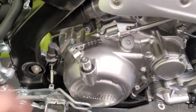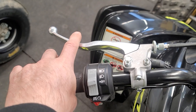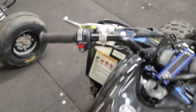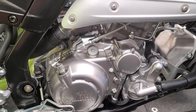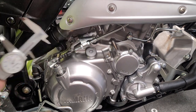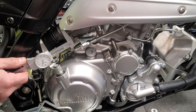From a standard adjusted position - we got about a quarter inch there, you can fit a nickel in there, that's your kind of guide. What I'm going to do is a one-finger pull, take the slack out of it, then do a full pull and measure the distance change. We'll look at a couple other levers and what they are doing. Pulling out the slack with one finger and we're going to measure here - pulling out the slack, we're roughly starting at zero.